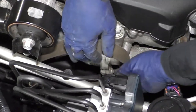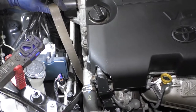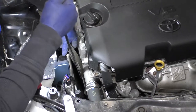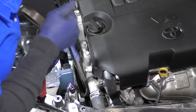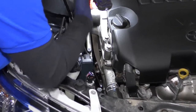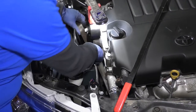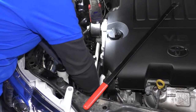Take it off all the pulleys — the crank is probably going to be the hardest one to reach from up on top. Now I have the belt off of every pulley except for the crank and the actual tensioner. You can't get the tool out because the tension's all the way down and it's bottoming out on the top radiator rail. So what I do is leave the belt on the crank, hold the belt, pull this pulley up, and hold onto the belt as strong as I can to take the tool off. It came off the crank. I took the belt around the crank, around the pulley, and brought it out back here under this wishbone mount motor support. Now I can take the tension right off, slowly let go of the belt, then slide the belt up off the crank and pull it right out.